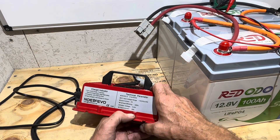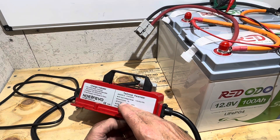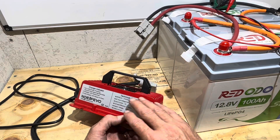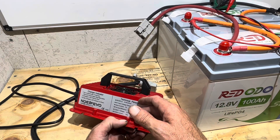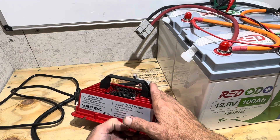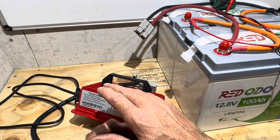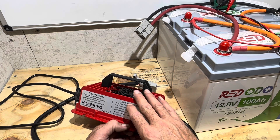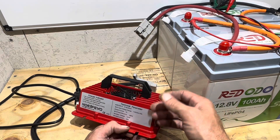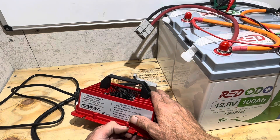So why did I pick this charger? First off, the price was right. I caught this on a coupon sale — $104.99 is what I paid. The normal price is around $110 to $115 depending on coupons. It's IP65 rated, meaning it is dust tight so I can leave it outside without dust getting inside and damaging the charger. And it's protected from low pressure water jets — it's not submersion proof, but it is water resistant. So you can spray it with a hose or leave it in the rain and it won't be damaged.